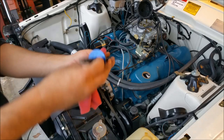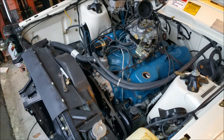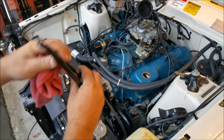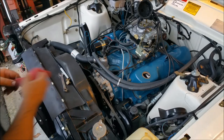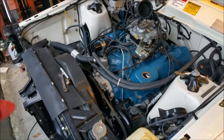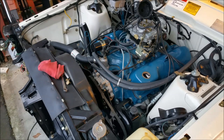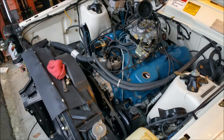That's a good tool. It doesn't belong to me. It's my brother's. It's an ARP tool. And it came, of course, with the other type, which is probably, I don't know what that is, maybe a small block Chev or something. And this has an ARP oil pump drive and all sorts of stuff in it. I love the Fords for that because they're not the Holden V8s and Rover ones, you need to prime the oil pumps. Where these being internal, you don't need to. There it is. Sweet. Cool. All right, well, we'll put it back and see if she starts.